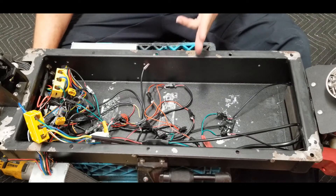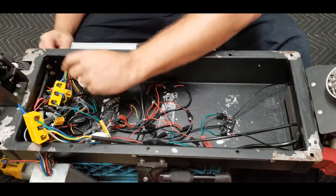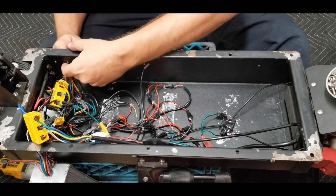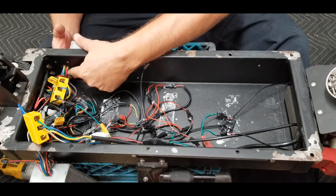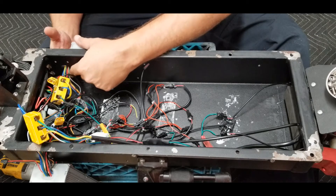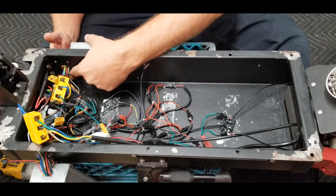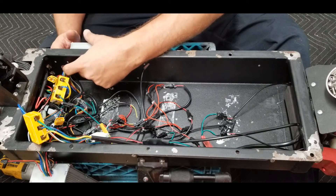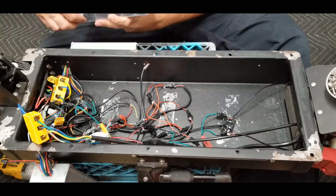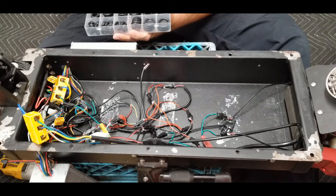One thing I noticed about this scooter — and there are a lot of scooters out there that have controllers on the outside — is if you see this hole right here, there are kind of sharp edges on it. What concerns me is that over time with going off-roading and bouncing around, these wires can eventually get chafed and possibly cause a short. So I'm going to be adding a rubber grommet — I got a rubber grommet kit off Amazon, I'll put the link below.